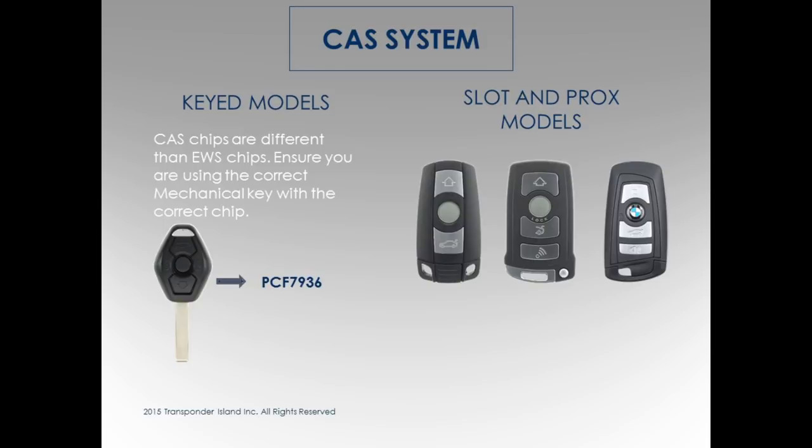It's got a different chip, a different board. This is why it's very important to understand that you have to know what you're working on and what you're using. If you try to use an EWS remote head in a CAS, it's just not gonna work. Try to use a CAS remote head in an EWS, not gonna work. Two different chips, two different boards.